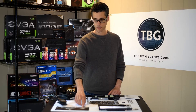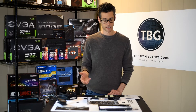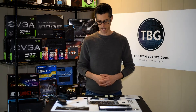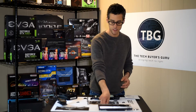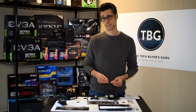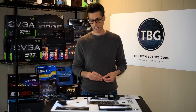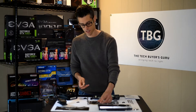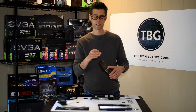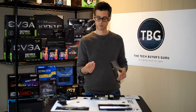For the most part, these screws are replacements for what comes on the Founders Edition card, which is good because some of those can be stripped when you're removing them. I'll be highlighting as we go through the screws that I'm using and the parts bag they come in — they're not labeled, but I'll try to identify what the screws look like. There are two screws that EVGA does not provide replacements for, which I think is an oversight. That oversight was also reflected in the disassembly process, where they don't mention you have to unscrew the original shroud from the I/O panel.